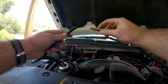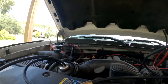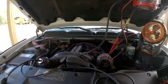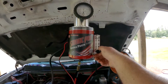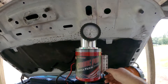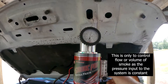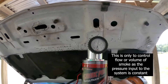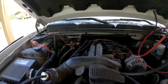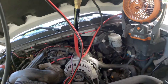I'm going to insert this into my hose. What I'm looking at, from this point past the air filter and that short section, is the entire intake to see if we have any leaks. Now I'm going to come back up here and look at our pressure gauge. We'll give it a second to start putting some smoke in the system. Basically you're looking around to see if you see any smoke.